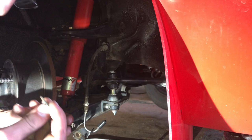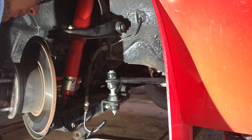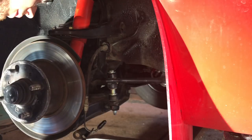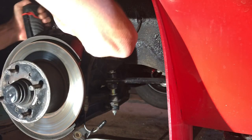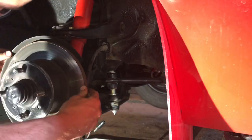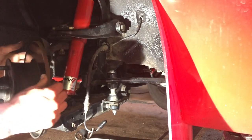It has a regular washer, so set that down and remember where it goes. These are 15 millimeters. I can't fit a wrench on that one — if I turn this I will. There we go, now I can fit it. Got it. So now that'll give us a little bit of freedom here — you can see how loose everything is now. You wouldn't want to be driving around on that, would you?